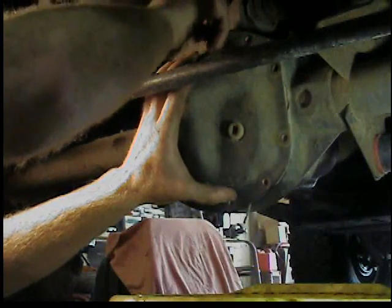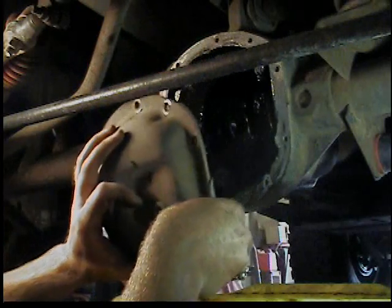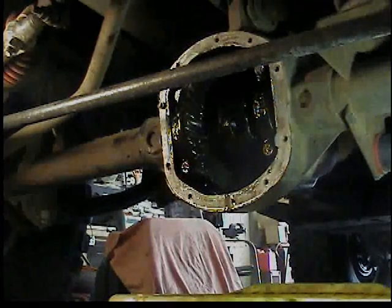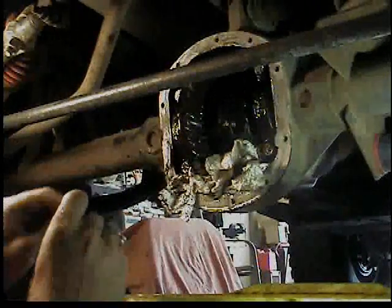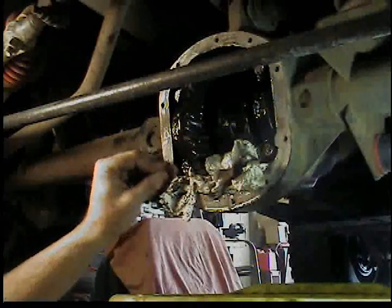This is probably the biggest hassle of the whole job — just cleaning. You've got to clean that cover, clean the gasket surface, get it all dry and clean so you can get a good seal on it. I stuffed a rag in the differential opening so old silicone wouldn't fall in. Then I went at it with a razor blade and scraped it all off — couldn't find my razor blade scraping tool so I'm holding it bare-handed. Don't tell OSHA.